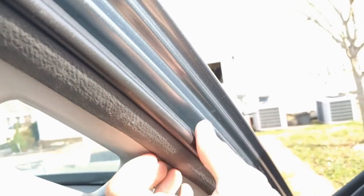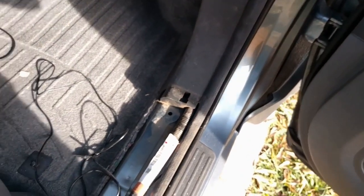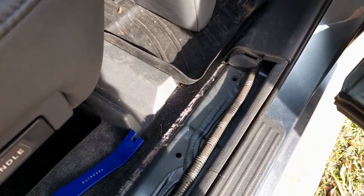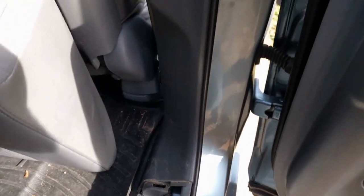I went to this seam and peeled back the panel here. There's a plastic panel, so I went from there over and then caught this molding — the weather stripping piece — and tucked the cable in, just peeling it back slightly from the door. This whole piece peels back just a bit so the cable runs down here. I've also popped off two trim pieces. They require a good tug — they don't come off easily — but when you pop those two off it loosens the adjacent piece just enough to snake the cable and tuck it between the carpet and the plastic trim, getting it all the way toward the back seat.